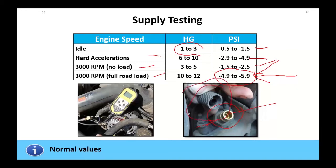The cap that goes on that port is the primary seal. That's what keeps it from sucking air and keeps contaminants out. So make sure that cap was there when it came in. If it's not, you've got to warn the customer and note it. Make sure it goes out with a new cap.